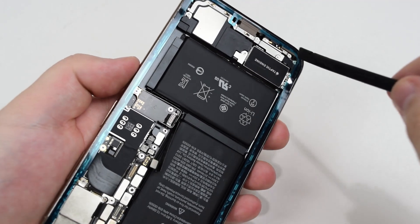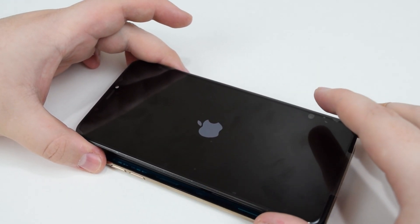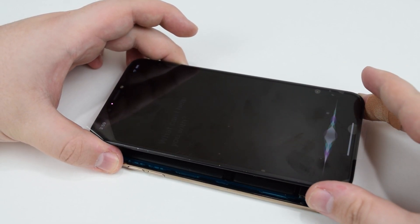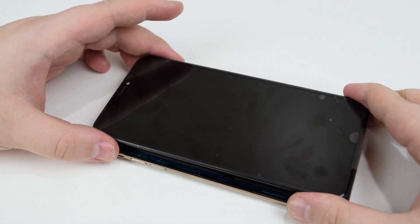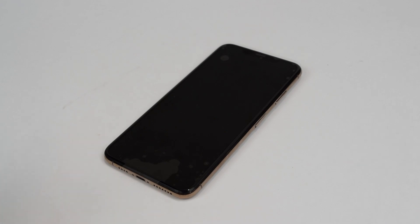Now I can plug in the brand new screen. There are just a couple of cables, and now we get to test it — I can hold down the power button and pray that there's an Apple symbol. And there we go, the Apple symbol popped up. After tapping a little bit, I'm going to hold down the power button again and slide it over so we can power off this device and continue the repair. We're almost done — all we need to do is put the bracket back on, make sure everything is tight and clean, take off the sticker around the edge, take off the adhesive sticker, and finish up the repair. Now being careful, I can seat the brand new screen back down on the phone. After getting the top in, I can gently press around the edges, crunching it all the way down. And there we go — now for the most satisfying part, taking off the plastic protector. Yeah, I like that. And just like that, we are done with the screen repair.